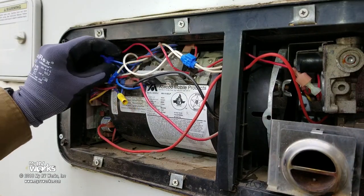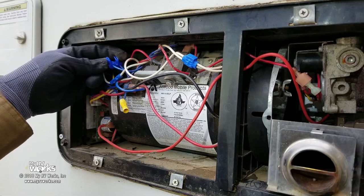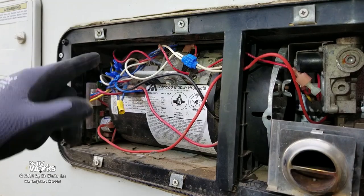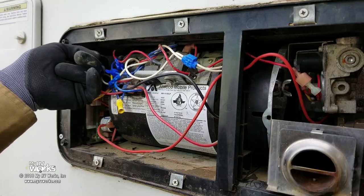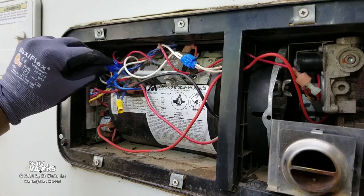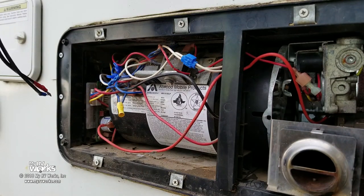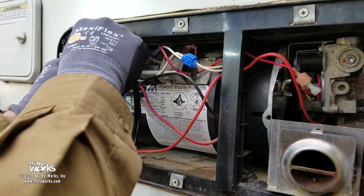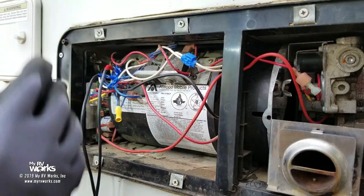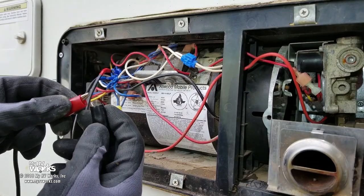I know the thermostat's good on the inside, but I want to own this furnace on the outside so I can start it and stop it at will without running in and out to the thermostat. When I tap onto these two blue wires — I've verified these two blue wires are coming from the connector that goes into the RV — one's going to be hot all the time, one's coming back through the sail switch. What I keep in my tool bag is this little wire with connectors, about a 10-foot wire. When I touch these two together, the furnace is going to start.